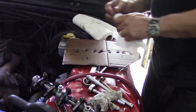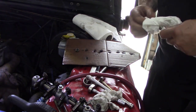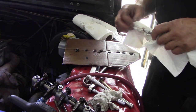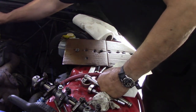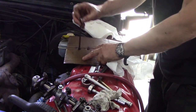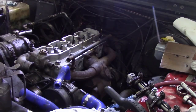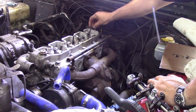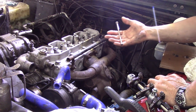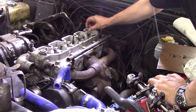That will add all sorts of problems. I've had bits and pieces of these engines break off inside — like the rollers for the lifters, I've had those snap up and break because they haven't been fitted properly in the past. Drop it in, push it and twist it, make sure they're all nice.